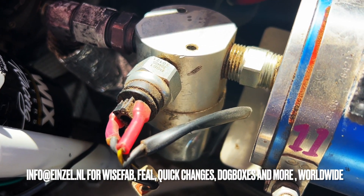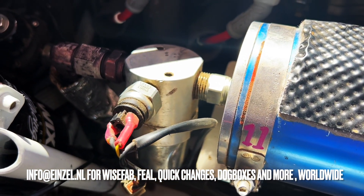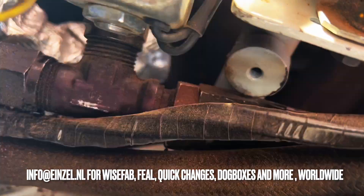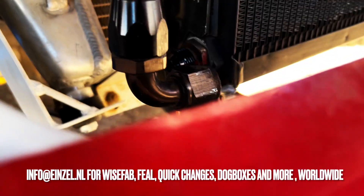There's another thing over here called the EPC valve, which controls what pressure it operates at — in our case, 1.5 bar. The outlet side is plumbed into the return of the oil cooler with a one-way valve, so it cannot flow back into the oil cooler but flows back into the engine whenever it releases.